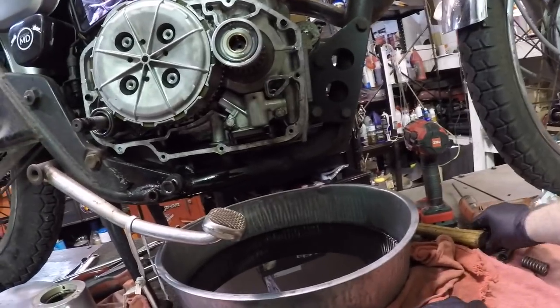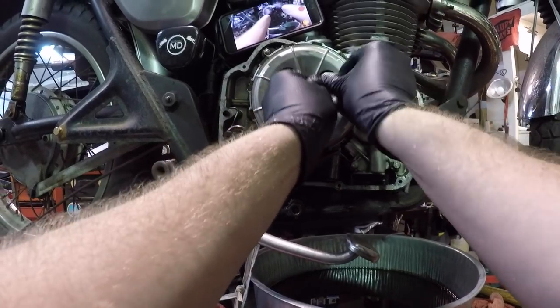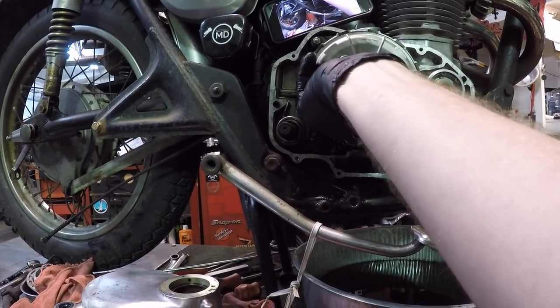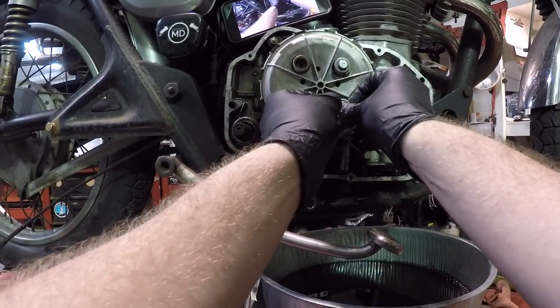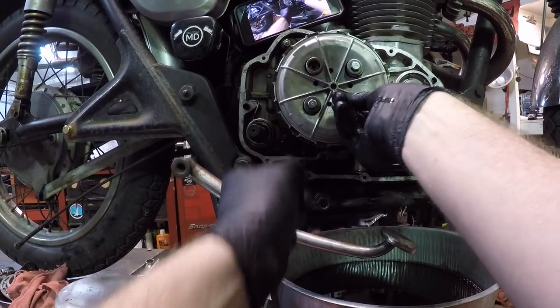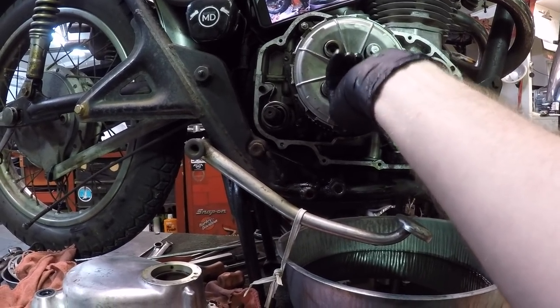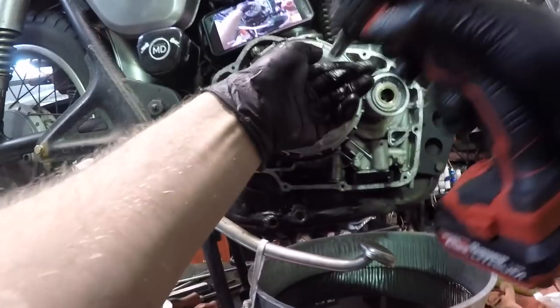All right, then what we'll do is we'll go ahead and install my makeshift stiffer spring, which is a little spring hack. Put those on, put the new spring in. Now these bolts do not take a lot of torque at all, okay? So you don't need to hammer them in when you're installing them. I mean, it's a very, very low torque, probably between, I would say, 6 and 12 foot-pounds. Not a lot at all. You just want them to really seat.